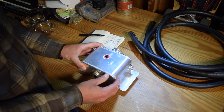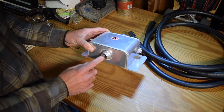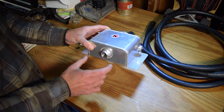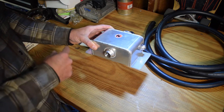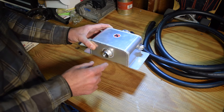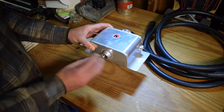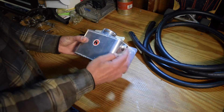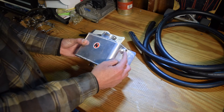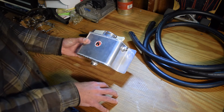The way this is going to set up is basically I'm going to have a T at the bottom — an NPT that comes off here and goes to three-quarter-inch barbs. I'll have coming from the water pump into the bottom here to do my overflow and expansion functionality. On this side I'm going to have my steam port, converting this to a 5/16 barb that goes to the steam port on the LS engine.